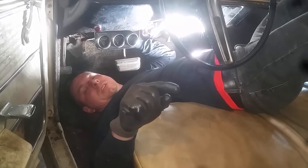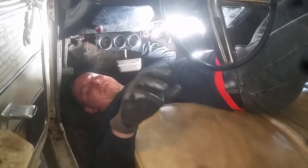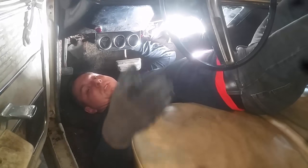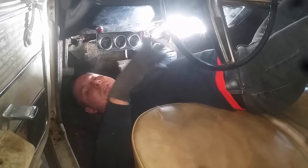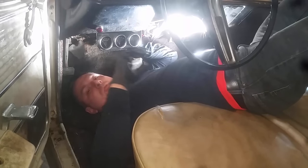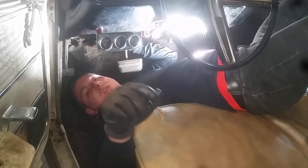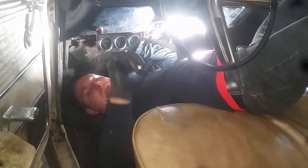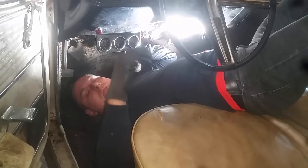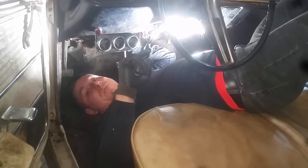How to do a budget disc brake swap. The swap itself costs us $239 for the kit for the front wheels, and then a non-power master cylinder out of a 68 Camaro for another $28 plus core. You're going to need assorted fittings and all, but under $300 you can do the upgrade from drum to disc without ever needing to actually buy disc spindles. And they will fit under 15-inch wheels for all of you that like the Pro Street look.